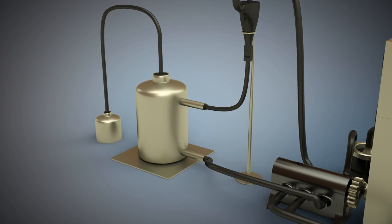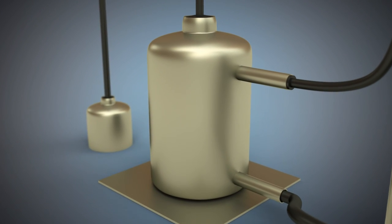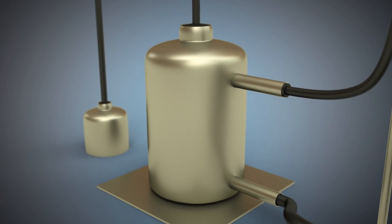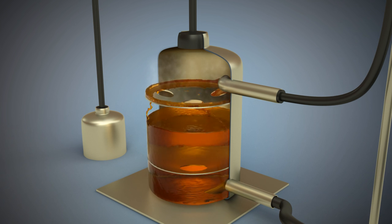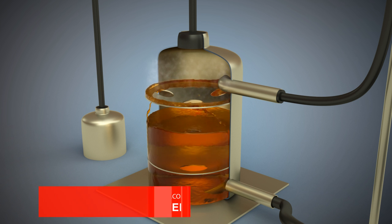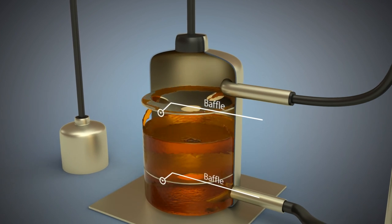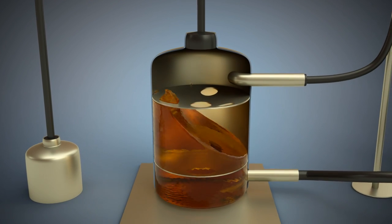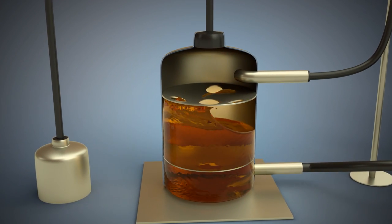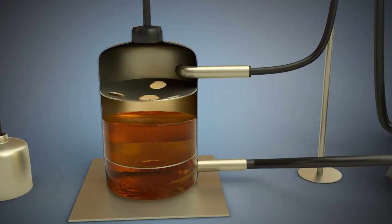The oil is stored in the oil tank, which is filled from above by a scavenge pump. The line to the breather tank is located at the top of the oil tank. The breather tank is important because air remains in the oil and this air must be able to escape. Baffles ensure that the oil remains in the bottom of the oil tank during extreme cornering, guaranteeing that there is always enough oil to be pumped to the engine. If air is drawn in, the lubricating films in the engine could not be maintained, resulting in excessive wear and tear.